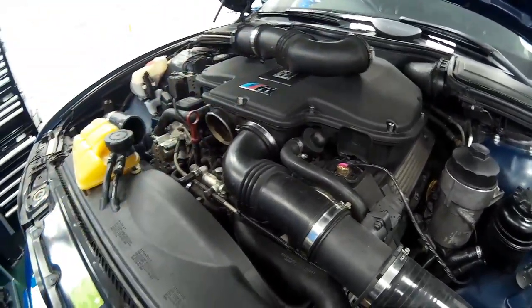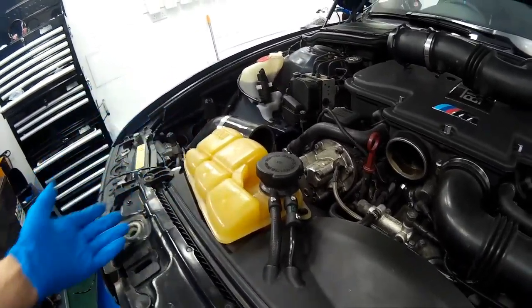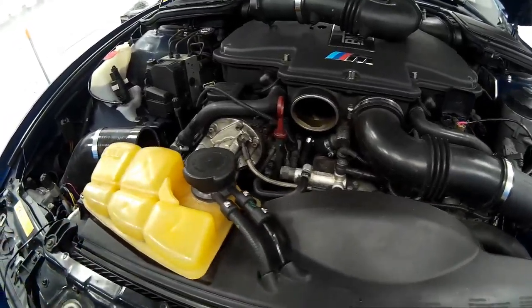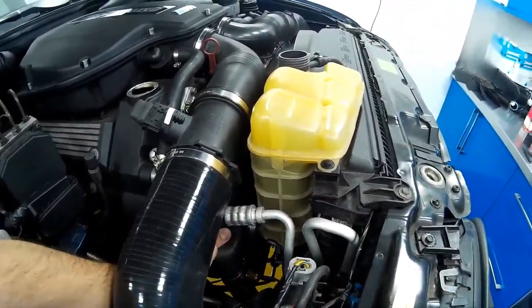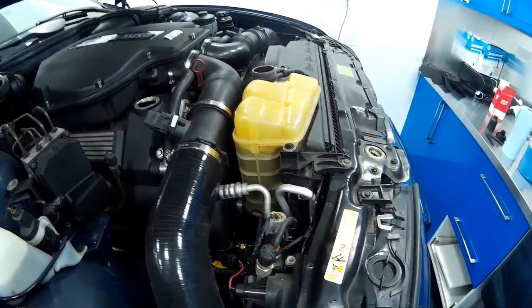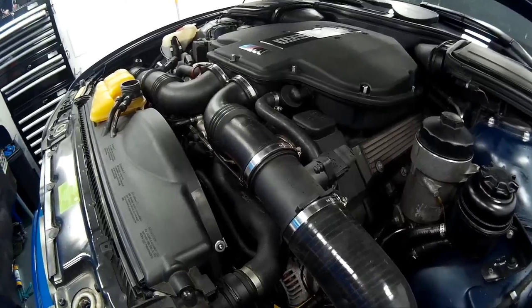The next thing is to refit the intake trunk and then bleed the system up with new coolant and distilled water to stop any corrosion — we live in quite a limescale-problematic area with the water supply so using distilled water will stop any limescale buildup as well. Once the coolant system has been refilled you can see it's up to the cold level. Squeeze the radiator pipe — if it moves up and down and the radiator pipes are full, the radiator's fully bled. The next thing to do is start the engine and allow it to warm up to operating temperature. I'm going to unlock the hidden digital temperature display on the iDrive so I can see exactly what temperature we're running at.